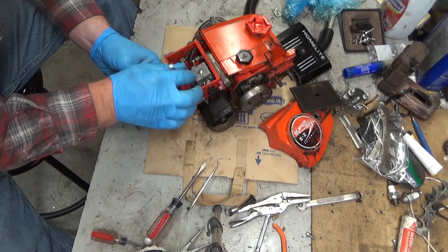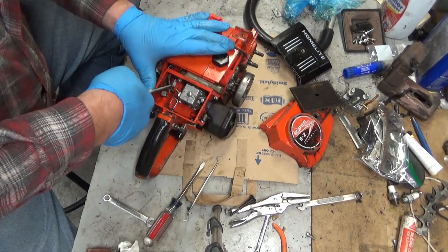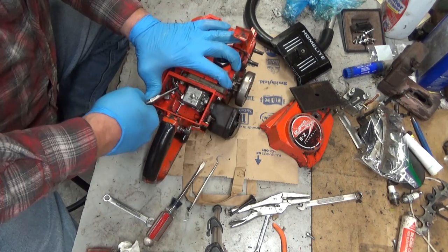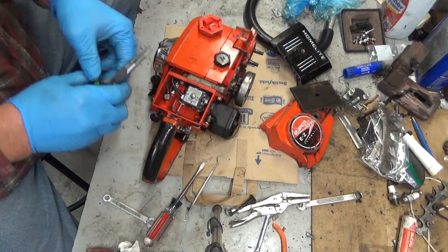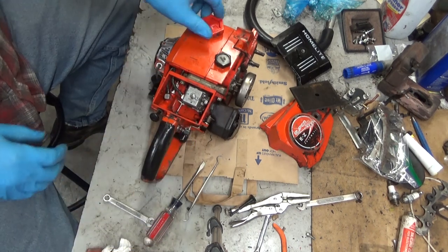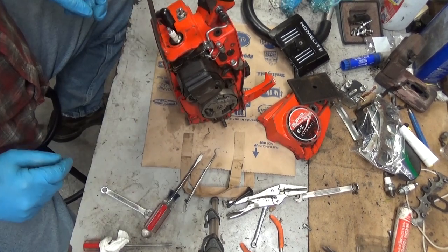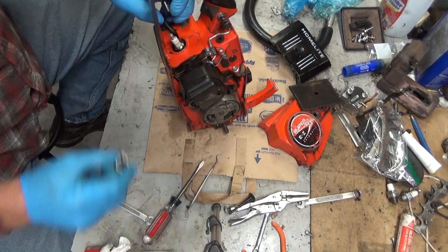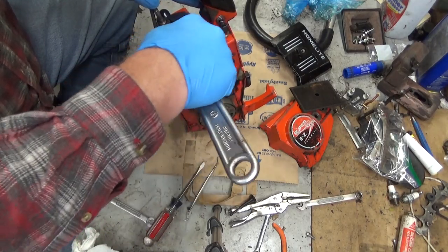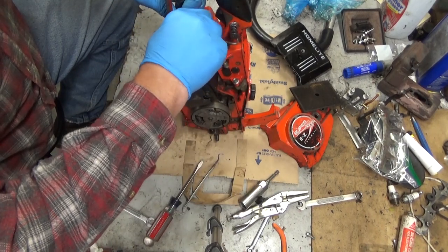Okay, same thing, you don't have to get crazy with these. Once you got a good seal, stop. Let's put our fuel hose back on. That must have been as far as it went originally, at least with this hose, which is enough. All right. Well, let's find out what the spark plug looks like after that little soiree. Outside, the plug doesn't look that old.